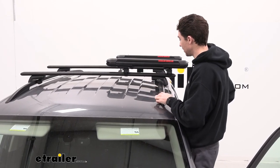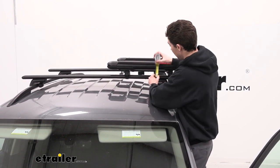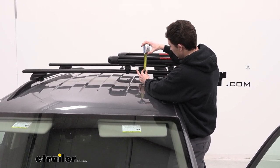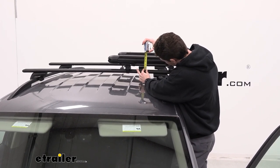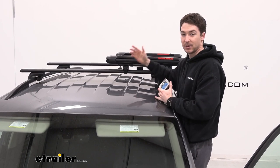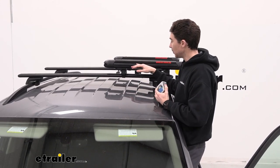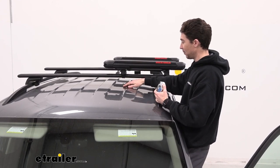From this point, I'll just get a couple quick measurements to give you an idea of what it'd be like to put this on your roof. The first measurement is from the top of the crossbars to the top of the rack — that's going to come in at about four and five-eighths inches. From the top of the crossbar to where your gear is going to sit, that's going to be closer to three and a quarter inches. That's the number you'll want to keep in mind first for that added height — will I be able to store it in my garage, will I run into any clearance issues? The second number, where your gear sits, you'll want to keep in mind as far as whether your bindings will make contact with your roof.